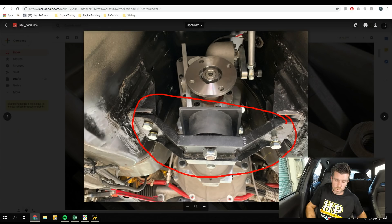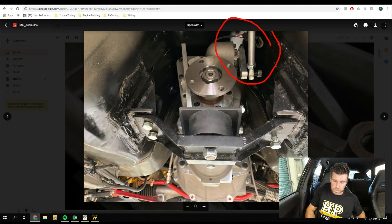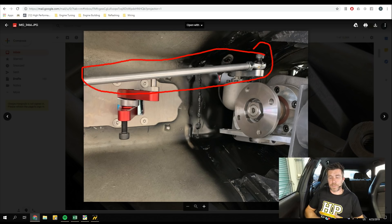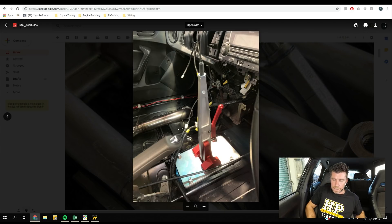We are potentially racing the white 86 this weekend. Continuing on with the 86 theme, we are still completing the gearbox installation in our black V8-powered 86. This is our TTI sequential six-speed box, and we can see the gearbox crossmember made up by our local fabricator. I'm in the process of making up some linkages for our shifter — here's an awkwardly positioned photo showing the shifter coming through the top of the transmission tunnel. These gearboxes go into a variety of different cars so they're basically supplied with a universal aluminium linkage kit that needs to be cut and threaded to suit.